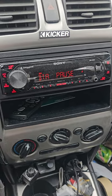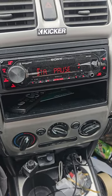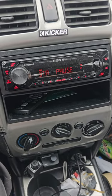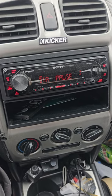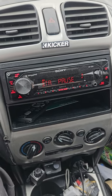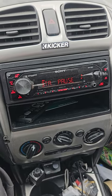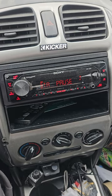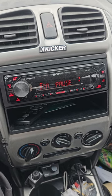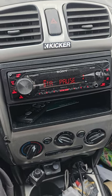Do the big three. You may not need a bigger alternator if you're only running three or four hundred watts, but you do need the big three — grounds at a minimum. Stock grounds on a small car might only be eight-gauge wire from the alternator, and even then the wire quality is questionable. So at a minimum, add some grounds. Stock grounds are just bolted to the firewall without grinding the paint for a good connection.